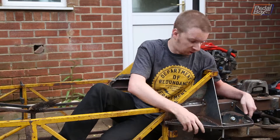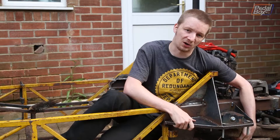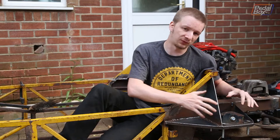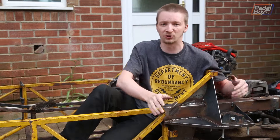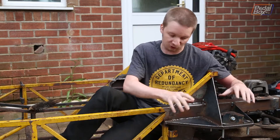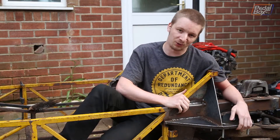This is the first of our new trailing arm hangers. It's welded onto the chassis fore and aft and all the way up the side structure here. What bolts onto it here is the front end of the trailing arm. All the way at the back there we've got the hub, and that's where our coilover unit is going to bolt on to take the weight of the car. So the only force this should be taking is the acceleration and braking force forward and backwards from the wheel. We've got a lot of strength forwards, a reinforcement strip across the bottom to help keep it flat and stable, and a nice big vertical reinforcement plate there in case we get any chassis twists. I think it's looking pretty good.